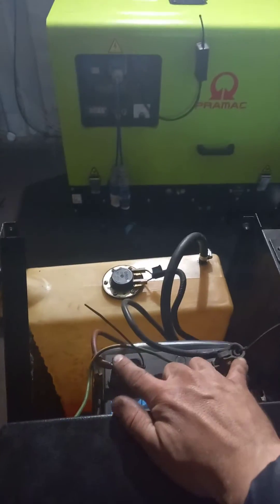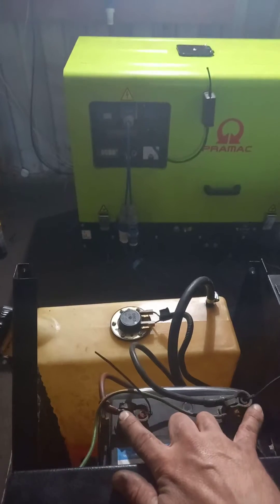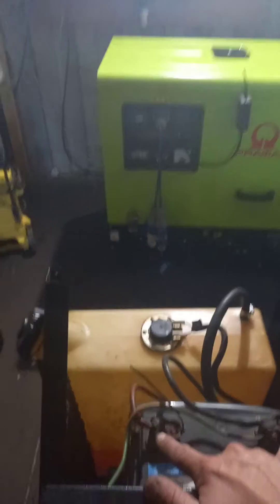The problem occurred with the new one, so I was able to check it on the second-hand unit. Before it was switched on I was getting 13 volts. When I switched this unit on and it was running fine, I would get 14 volts coming back through from the regulator. I'll show you the regulator down the back.